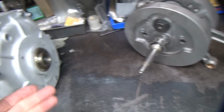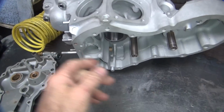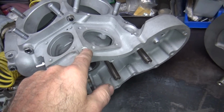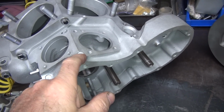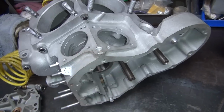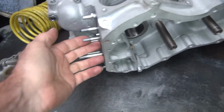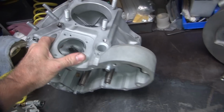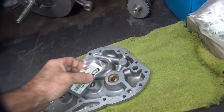And it'll have no oil going up to your top end, because normally a top end oil feed comes up through here on a regular motor. On a 65's external oiler, or 63, it comes up through here, and there's a tube that goes up, and the crank will suck all the oil out of the motor, go right over in here, and none of it goes up. There's no pressure, it just sucks it all out. So that's a problem we've come across over the years.